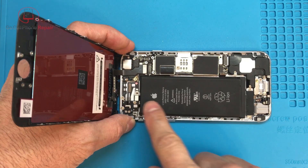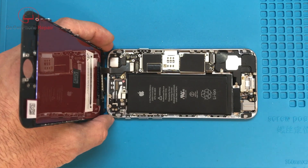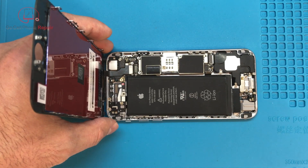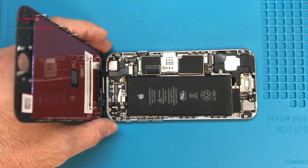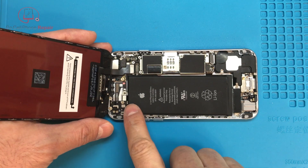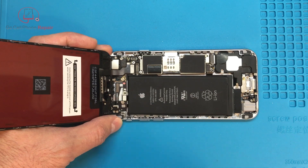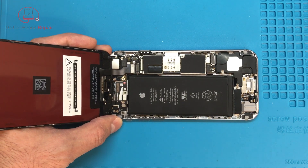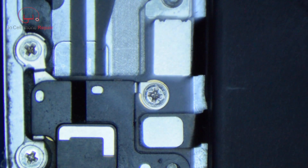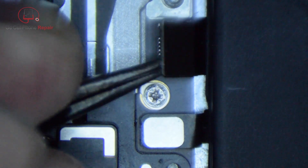I'm going to go ahead and plug one more in just to test it and confirm that that's the problem. Normally I would just take his word for it, but I have a cable here I'm going to plug in and double check. I have a feeling we're going to get the same response. In the meantime, I'm going to get this under the microscope and see if the little pin there that we can short to turn the phone on is going to work. If we disconnect this cable, we should be able to short a couple of pins on here with the battery connected and get the screen to fire up.